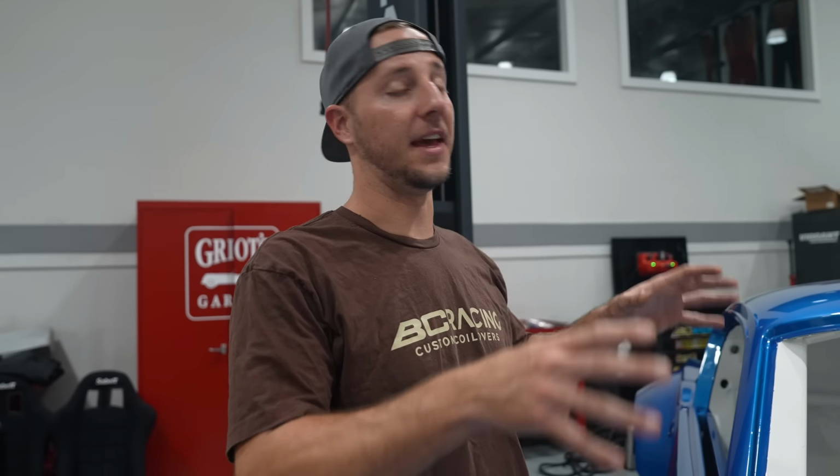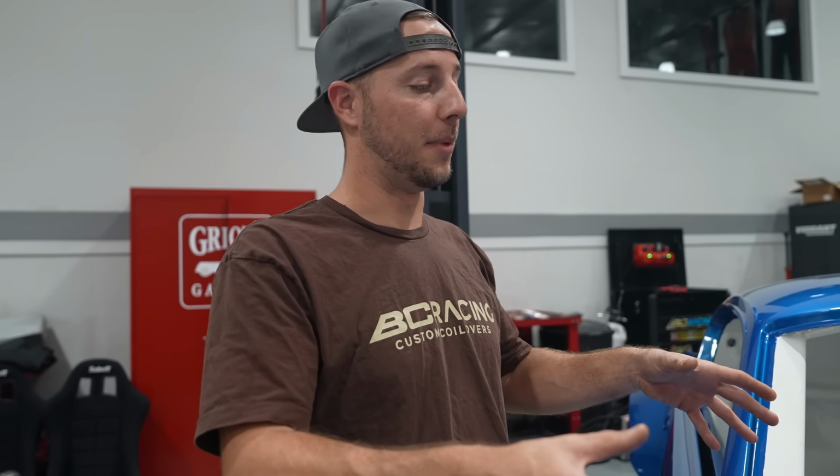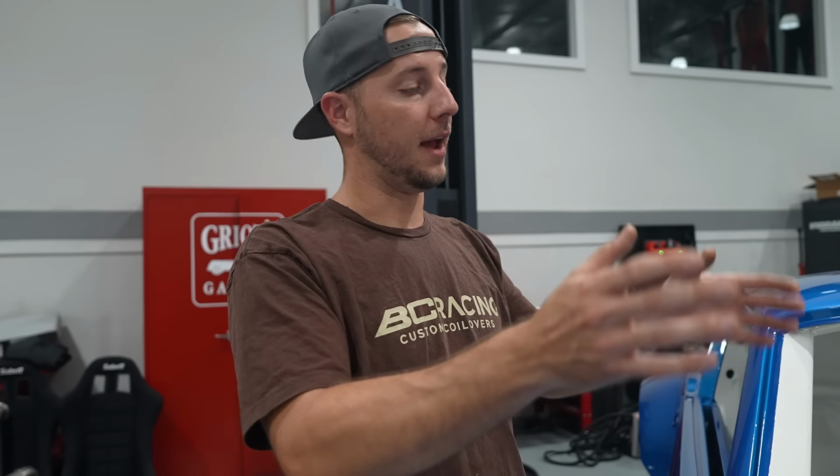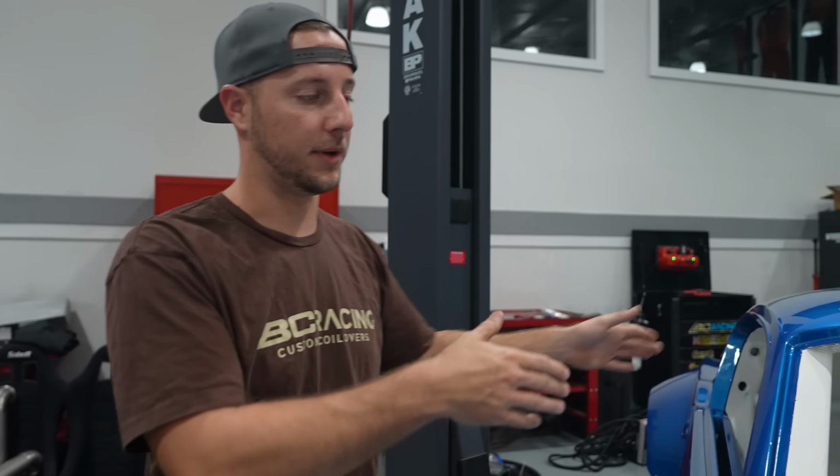I asked them if they built the turbo manifolds without a transmission on. They said they had a different transmission in place when they mocked up the motor and made the turbo pipe. So now they're gonna bolt up the turbo manifolds that go from the engine to the turbos, and then put the trans in place, and then from that position they make their trans cross member wherever the trans ends up falling. And drive shaft, all that. Kind of ass backwards, but my transmission's not even here yet.